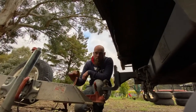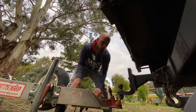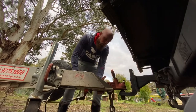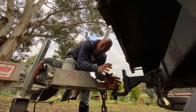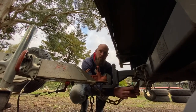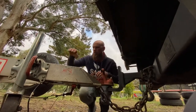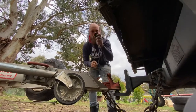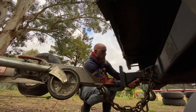First things first, you're going to have your brake on your trailer, so you're going to want to pull the brake off, maneuver the trailer and lift it up — two people if necessary, or use your dolly wheel if it's really heavy. Slide it onto the tow ball. Once you're on the tow ball, you've got to unclip this release, which will lock the trailer to the tow ball. Next, get your chain — I don't have any shackles on mine because I've got the hooks. Push them onto the hooks just like so. Brakes off. Pull your dolly wheel off — you don't want to drive off with that on. Get your brake controller and lights and plug that in. It's as simple as that.